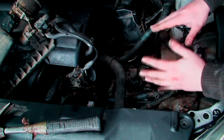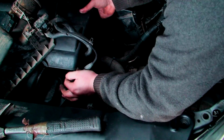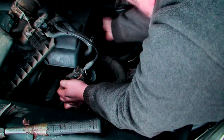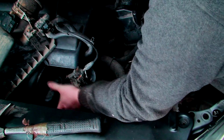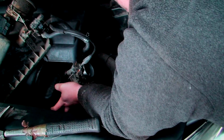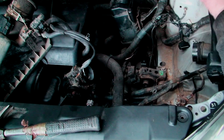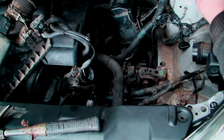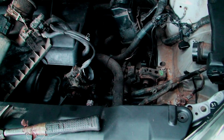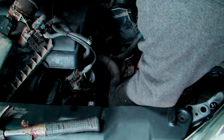It's on, it's in, but obviously the engine has moved over this way, so we need to push the engine. But the problem with doing that is it might not stay. I need to push the engine back towards the back of the car. And yeah, this is the problem. The engine is kind of twisted out, so I'm going to have to maybe push the jack in a bit more, try and force the engine to the back of the car. Now, did that move? And yes, it did.